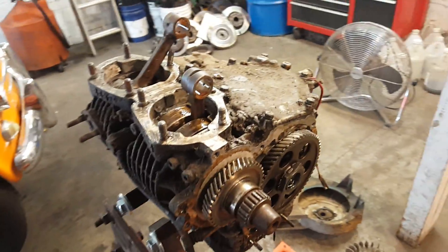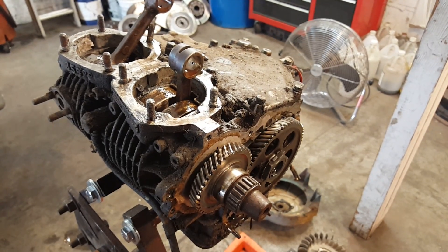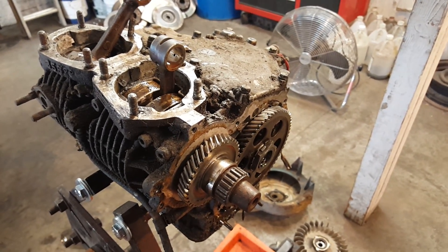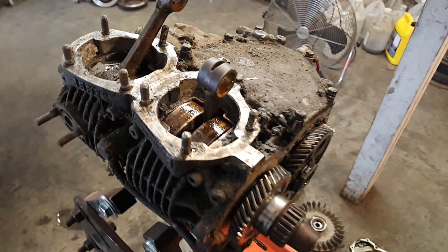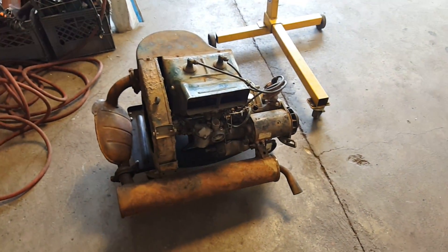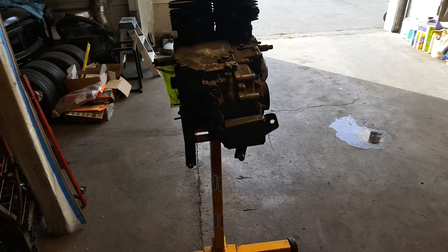I'm going to take this crankshaft out and make sure it's good. If it is, I'll probably clean up this gearbox and reuse it — look at the synchros, check the bearings on the crank and in the transmission housing. I've got some upgrades to do to this driven gear so it doesn't fall off, plus the overdrive. I might put this in a car, so stay tuned. And back to these other engines — they are works in progress as well. Beautiful little things, aren't they. All right, thank you for watching.